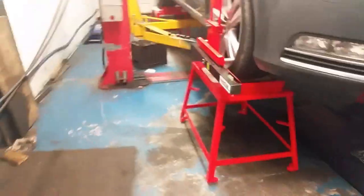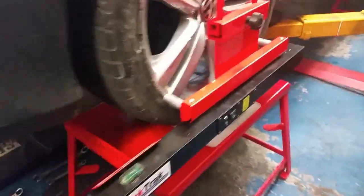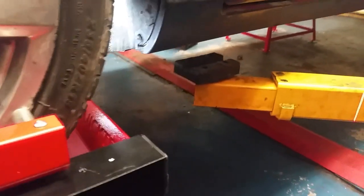Whenever you bring the car down from the vertical position onto these tables, the wheels move out a good inch or inch and a half. So it's not just that you want the wheels to turn at the front freely, but they need to actually push out. The bottom pushes out a good inch and a half. So they slip laterally, and the front ones they rotate. Especially the back, because when you lift the car up, as you know, the wheels hang way down.